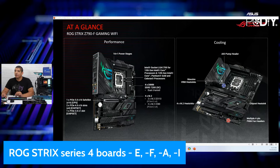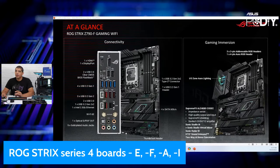With the dash F, you can see here you have just a high performance M.2 based heatsink, but not Gen 5, not the larger heatsink. A reduction there to the USB 2, but you still have lots of high speed. You still have 20 gigabits on the rear, 10 gigabits on here, and 5 gigabits there, right? The internal Type-C connector is also going to be a 20 gigabit connector, so both 20 gigabits internally and 20 gigabits on the rear. Reinforced USB 3 header that's going to also be on there, Thunderbolt header, and 4 SATA ports, Q release, and also this board has Q latch. You'll also see that the dash E has the debug LED. This one does not have the debug LED, but it does have the Q code LED display. Audio design is going to be the same, 4080 with the Savitech audio amp, and then three RGB headers, just like the three RGB headers that are also going to be on the dash E.